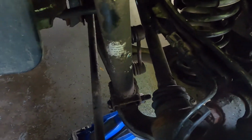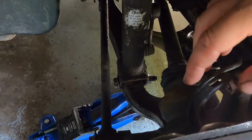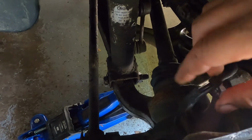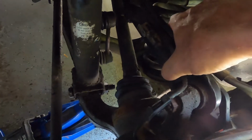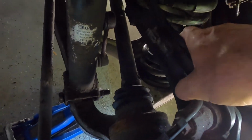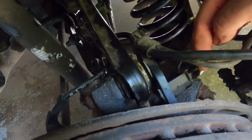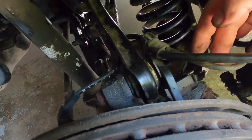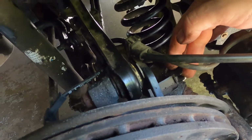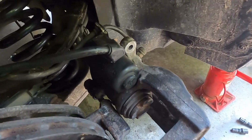Okay, so everything's bolted together for the suspension, but I still have to go back and retorque it. Now I'm just going to go and replace all the cables back in their holders. So this is for the wheel speed sensor, and then connects up in here, and then this whole thing snaps back into that arm. There's a little pin, and then that's all good. And here you have the holder for the bracket for the brake sensor, which I still have to fix. And then after I retorque all the nuts and bolts, all I have left to do is put the brake back on.